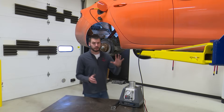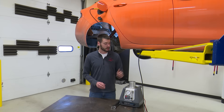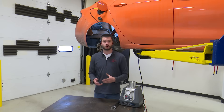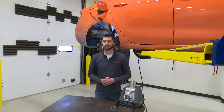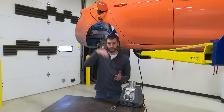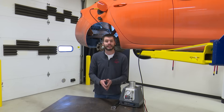I've already hooked the smoke machine up to this thing because I want to replicate putting fuel in it — we've already seen it doesn't accept fuel. Now, this Chrysler system is a little different than what I showed. It's not your traditional purge-and-vent style system; it uses an ESIM module, which kind of takes the place of the vent solenoid. But the main principle is the same: when we dump fuel in, we need to evenly exchange that for getting the air out of the system.